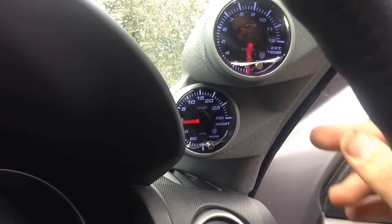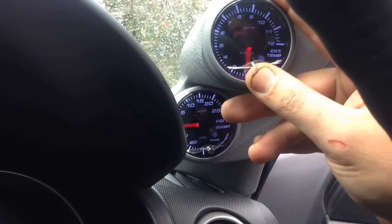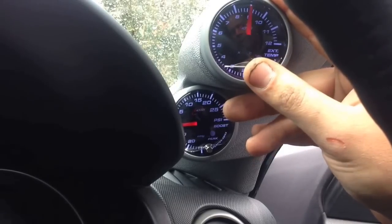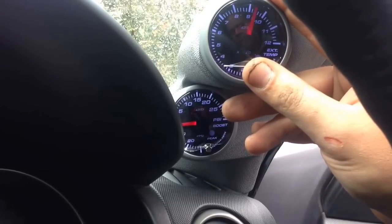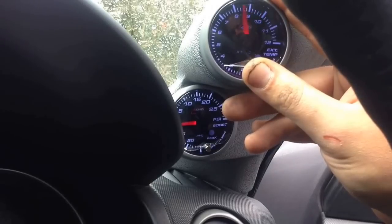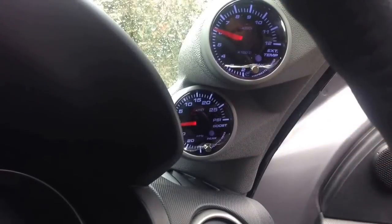While they're in operational mode you want to set your limits. For exhaust gas temp, hold down the button — it shows 900, which is way too high for a diesel. Hold the button again and the needle moves. I'm going to set this one on a PK Ranger to about 600 degrees. You get fine movements just by tapping it. Let go and that saves the position.